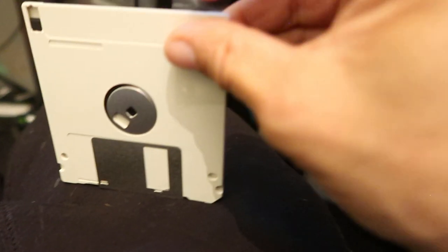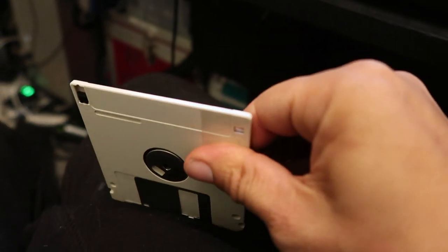You've also got to remember to use the right floppy disks — ones that don't have two holes on either side. On one side you've got the write protect tab, and there's also a second hole. Those are double density versus high density — different versions. If your disk has two holes, just cover one of them over with a bit of sellotape or something like that.